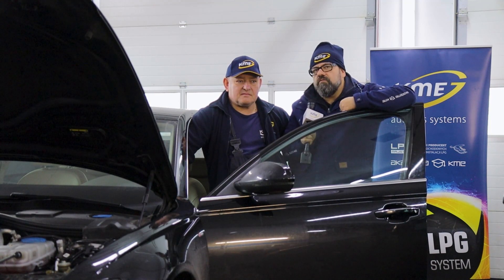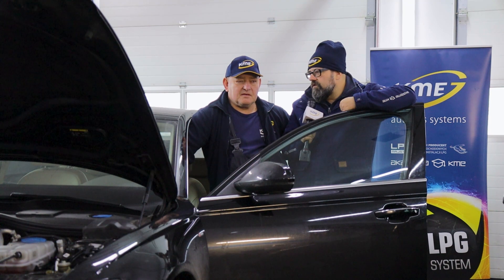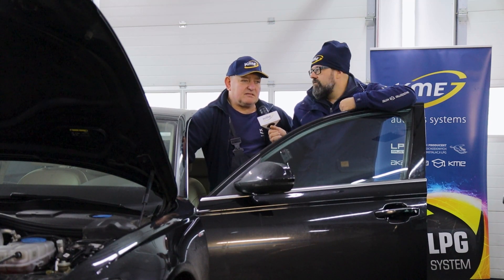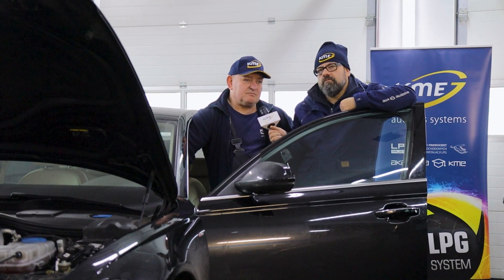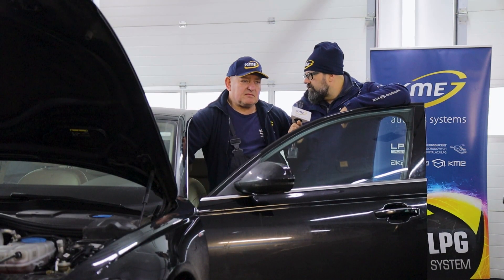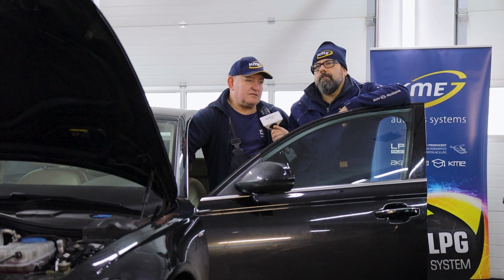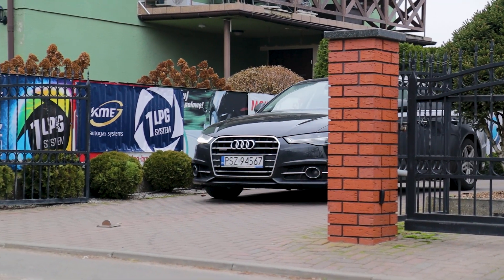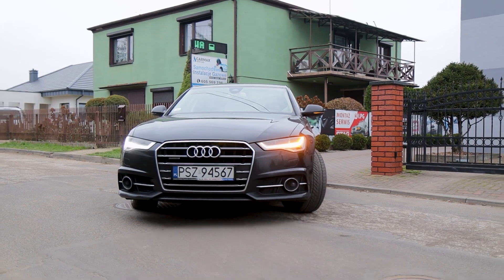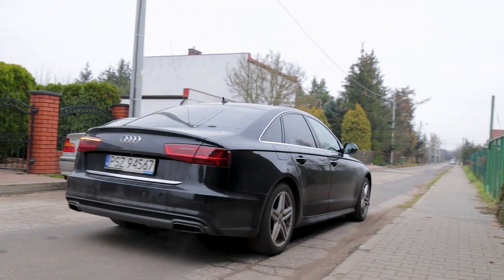We replace the lion's share of petrol with gas. A common question is: what is the petrol supplement? About 10–15% relative to total fuel consumption is injected — roughly half a litre per cylinder, so about 2 litres total. On overall consumption of around 10–11 litres in a car like this Audi, at a calm highway pace you'd probably go below one litre of petrol supplement. It depends on driving conditions — city or highway. The supplement is not delivered evenly; it depends on load. Higher speed needs more fuel, so the supplement is larger; in the city it's smaller because far less fuel is needed overall.